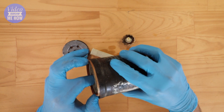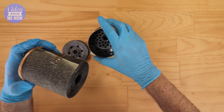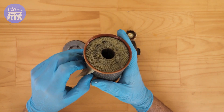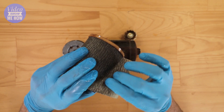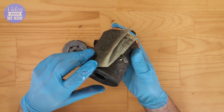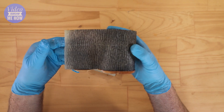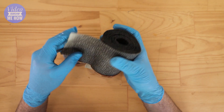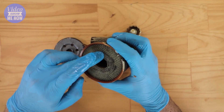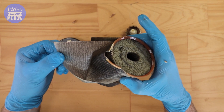Let's see if we can get this filter material out — there seems to be a sealing flange around the outside. Here's our actual medium itself. Pulling some of this apart — you can see that it is quite papery. I don't know exactly what it's made out of, but it's a pleated material wound around and around. To give you an idea, this is after about 5,000 K's, so it's not too bad — not too much dirt in here, though it is quite dark, so it's probably good that we changed it when we did.